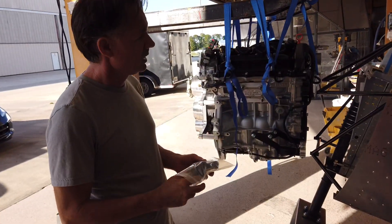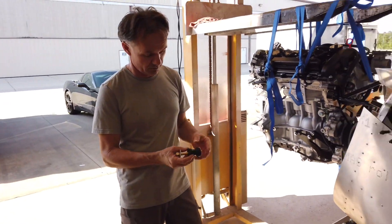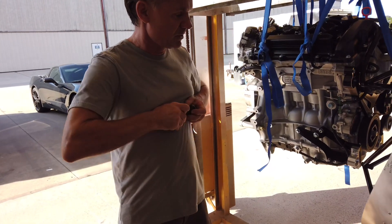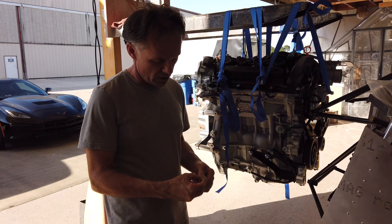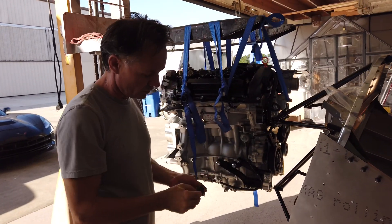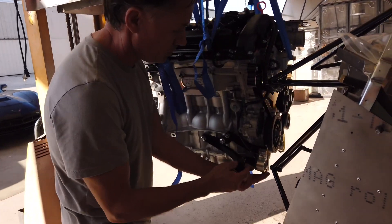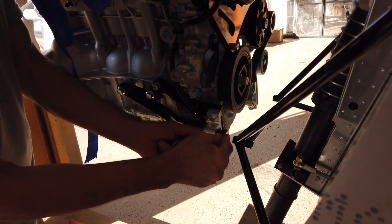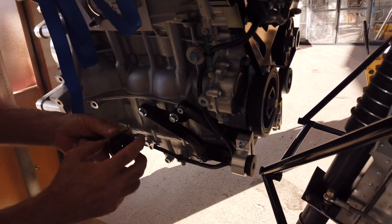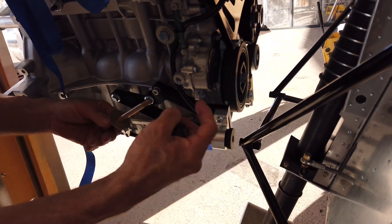Get your engine mount bushings out — these are silicone-based. I'll mention right off the bat: you'll see little hairline cracks on the edges within days of mounting them, and that's just how silicone is. They're not FAA certified but they are softer and they're allowed on homebuilts. We get the advantage of less vibration into the airplane. Now, each bushing has a steel insert inside, so when you torque it down there's no real torque value — you just tighten the bolts until everything is solid: the bolt hits the bushing, the bushing hits the mount, and the nut hits the mount. You'll clearly feel when it's bottoming out.